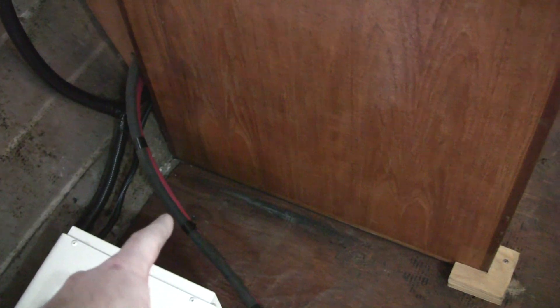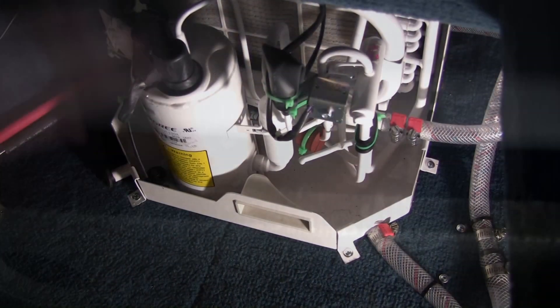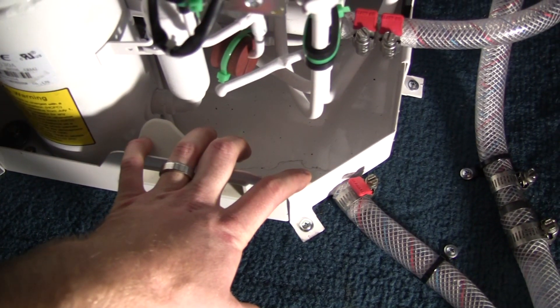Now, if they put it over here, you're going to need to make sure that there's an air hole underneath this dinette seat, because from what Bert said, it's only going to be an inch away. So we want to make sure there's enough clearance there for adequate air flow to go back to the AC unit. And down here on the bottom, we've got the condensation tray, which is basically going to collect all the water off the evaporator coil right behind this air grill back here.